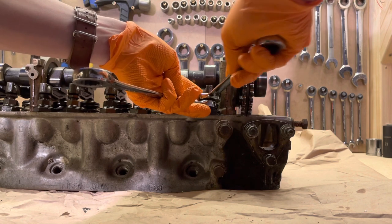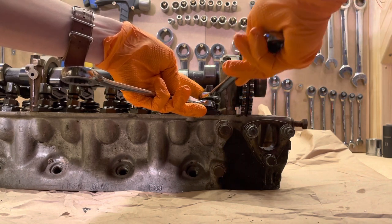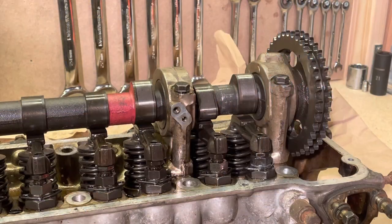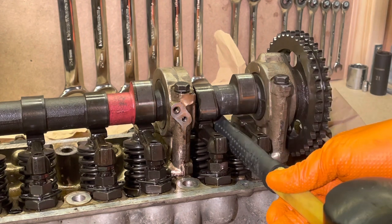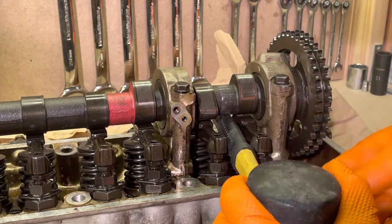You'll feel it when it starts to stop, or it might start turning the lock nut itself. Then you can take the 17mm wrench off and rotate the pivot in until you cannot anymore. If you tried to pull the rocker arm off right now you'd notice we're just about all the way there — we just need a little bit more clearance, which we'll get by compressing the valve spring down.